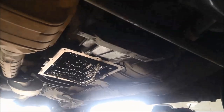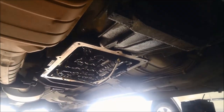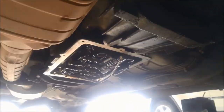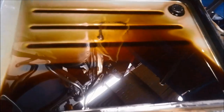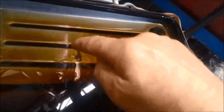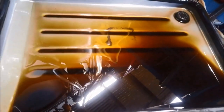Now, doing an improvement on an automatic transmission, I'll show you how you can keep the transmission a lot cleaner than how they come out of the factory. We've got the pan — you can see the mark where the filter inlet is. It's actually accumulated a lot of fine metal there, and you've got the magnet there. So all the solenoids would be thoroughly contaminated.